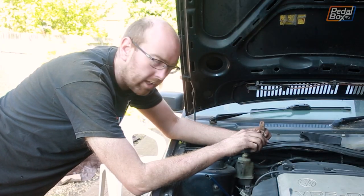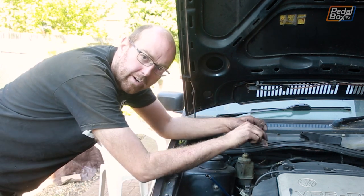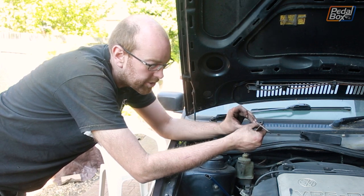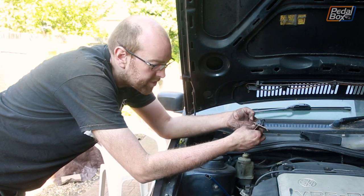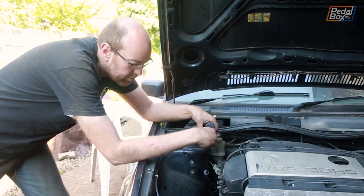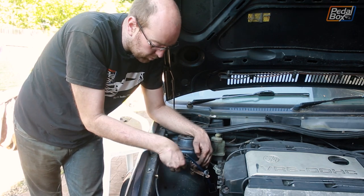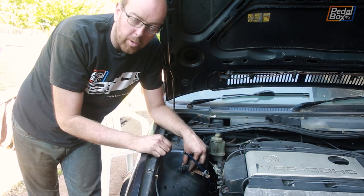The intake and air filter are held up by the throttle body and a little bracket that bolts onto the front of the suspension tower. What I'm going to do is add a little extra bracket with a threaded section that goes in down here, exactly like it would on the original car, and then some tabs that this will hang off. So this will bolt on down this side with the air filter onto there, and the bracket will sit approximately there with the tubes coming up into the top.